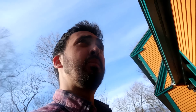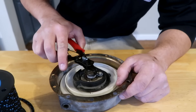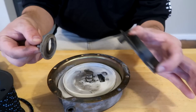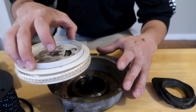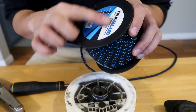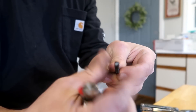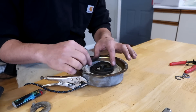There she is. I don't think I have any pull rope with me here so I'm gonna have to go buy some — probably pick this up tomorrow. It is time to fix this frickin recoil. The first step is to take this snap ring off without poking your eye out. Remove this, remove that. Here's the tricky part — you gotta lift this thing up without letting the spring come all jumbled up, because then you've got serious issues. There's our dead rope. Look at this — brand new roll, a hundred feet, true blue heavy-duty commercial starter rope.